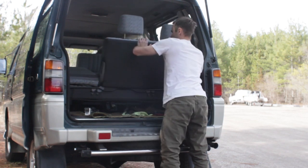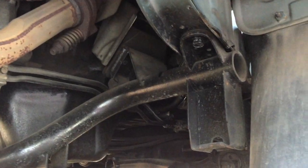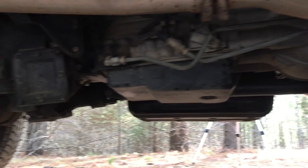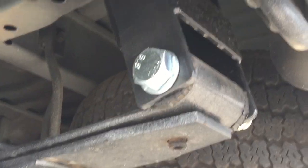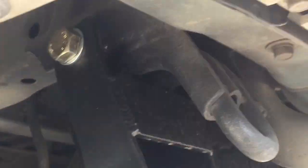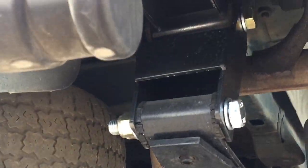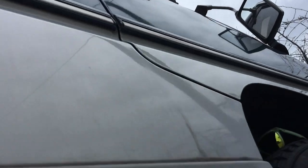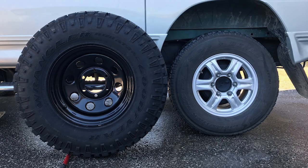This van was just bought in Japan. It was very well maintained and had service history, including a recent timing belt job. The body is completely unmolested, and underneath is pristine. The client wanted some work done with the ride height, so I commissioned a local business called Respeed to make extended shackles so I could drop the rear leaf springs, giving it a nose-dive look with the rear end sitting two inches higher than before. Then I cranked the front torsion bars all the way out to raise the front by two inches, resulting in the van sitting fully two inches higher and allowing for 31 inch by 10.5 inch AT tires to be fit.